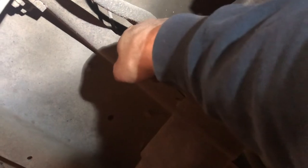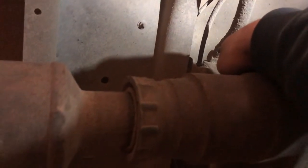I'm going to show you a little life hack for getting around having to go way under the back of the truck for those fittings. You'll need two wrenches — bring a 13, a 13/16, and a 3/4. You want to hold one fitting and turn the other. I put lube on these — I don't know if it helps but it's just something I've always done. I'll put you back into the time lapse.